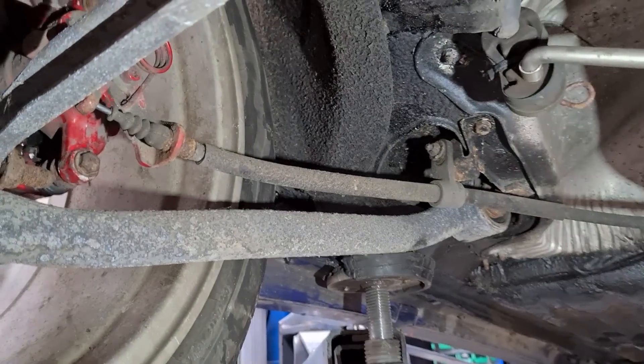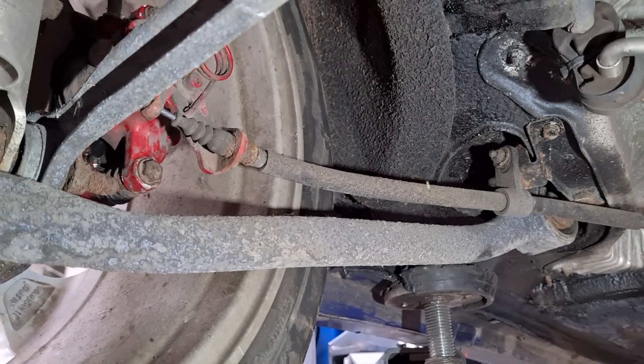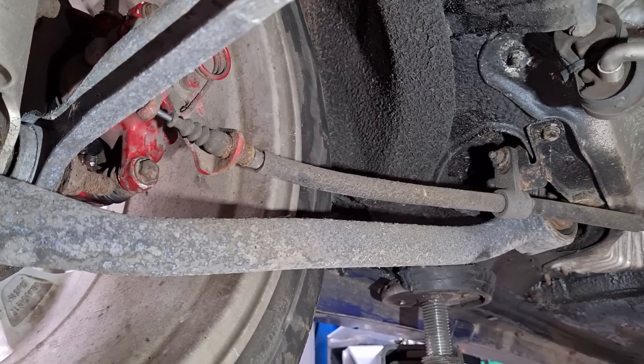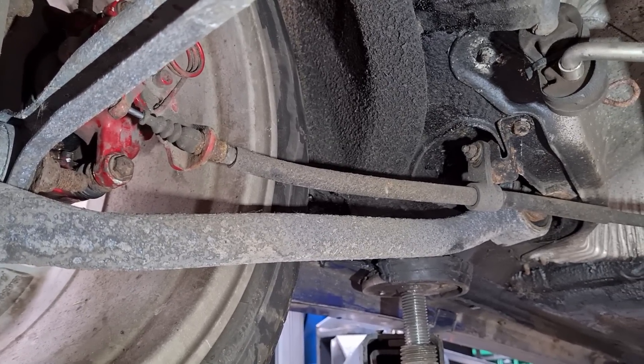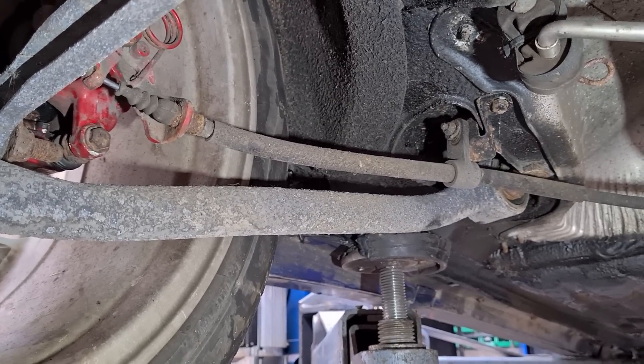As a lot of these GTAs spend a lot of time sitting on people's driveways rather than being driven, the handbrake cables can start to rust and seize on, or not give you the best braking effort. They're not expensive to change — about £40 to £50 for a set — and it is a DIY repair that will take no more than an hour on your driveway.